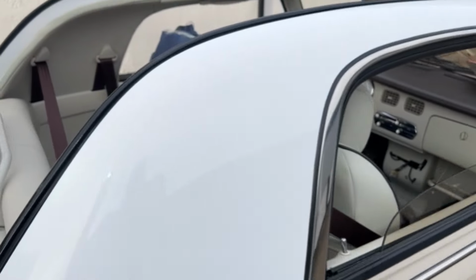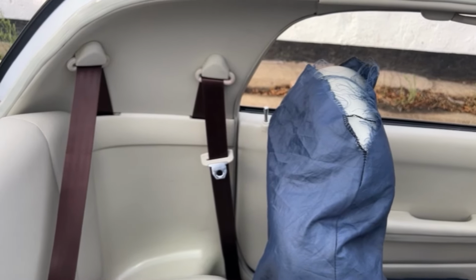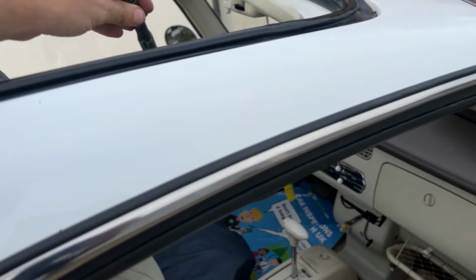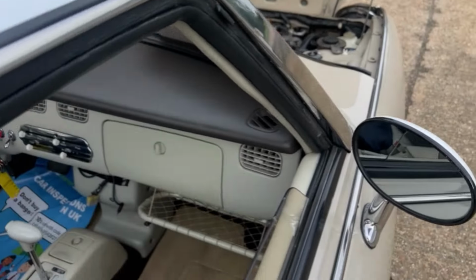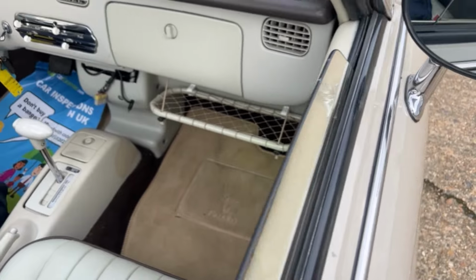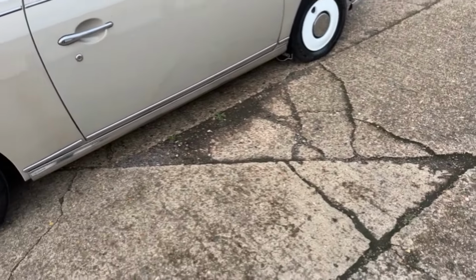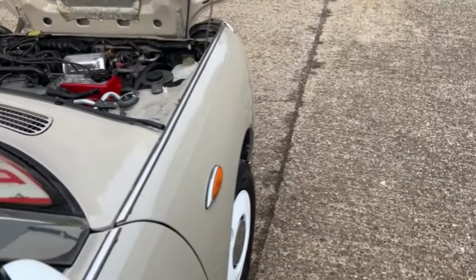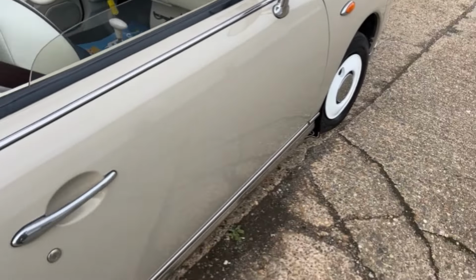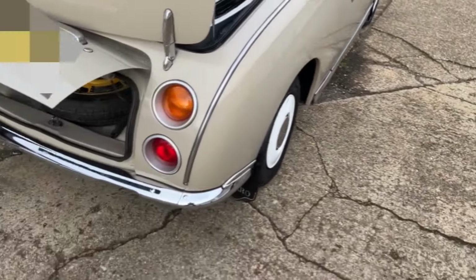Floor, that section there, some corrosion developing on the floors, on the side. As much as I can say, I can't lift all the carpet up, but there is evidence of some light surface corrosion. There has been some welding done as well to the floor, this side and that side. As I said, where the seals are bent, that's probably an incorrectly jacked up vehicle before.